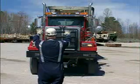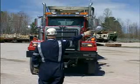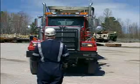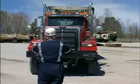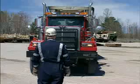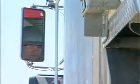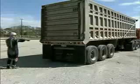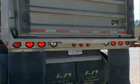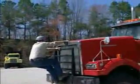and other functions. Signal the operator to turn on the headlights, check high and low beam, right and left turn signals, and emergency flashers. Check windshield wipers and horns, steering wheel and air. At the rear of the truck, motion the operator to check the park lights, turn signals, brake lights, emergency flashers, and backup lights. Move back to the operator's compartment and ask the operator to raise the hood.